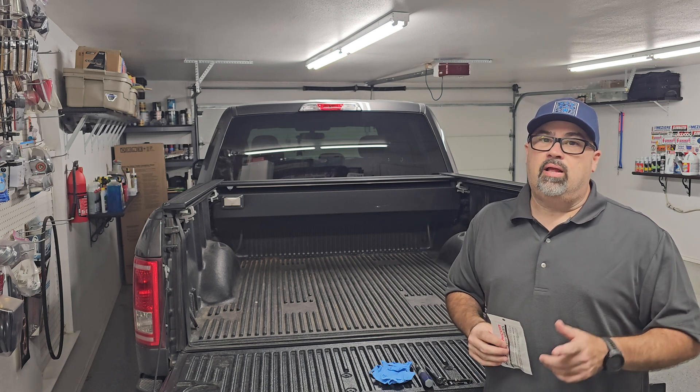I'm gonna rotate this around to the back side so you can see it. These plugs just rotate about 40 degrees, and then they should carefully pull out of the socket. Once it's out, go ahead and pull — the bulb just pulls directly out of that socket. I'll let it hang there and be very easy with it. Go ahead and grab our first clear bulb and just push it back in, then reinstall — it just goes into those slots. Twist it back into place and repeat that step.